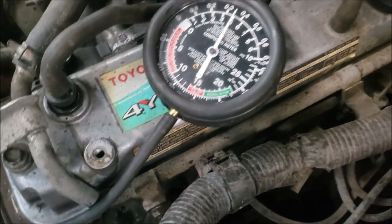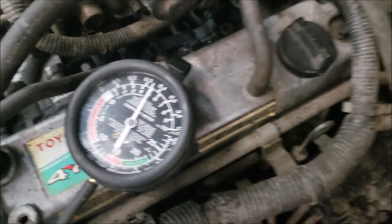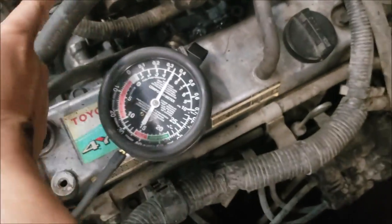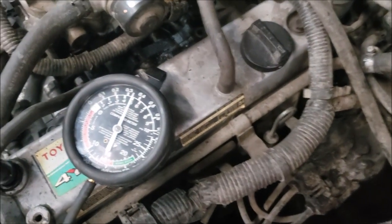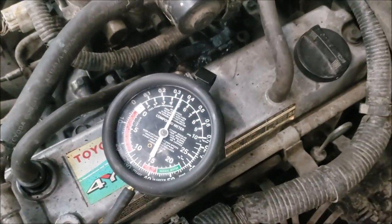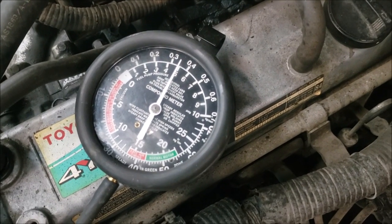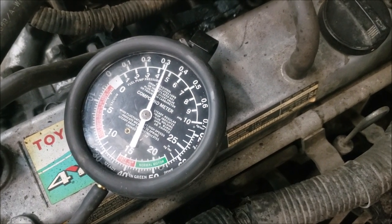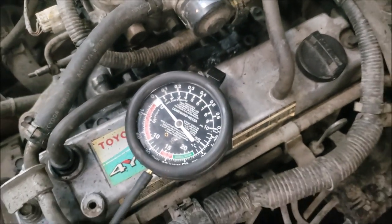What's happening right now is I think I screwed it in too much — it's not allowing any gas into the passage now, because my pressure is being held. The passage towards the FCM has been blocked. Let me unscrew it counterclockwise and see what happens. Now the passage is open, so whatever fuel is there is going into the FCM. Let me try again.